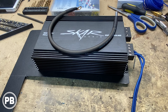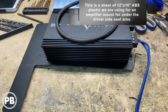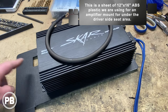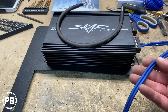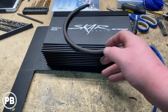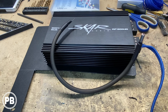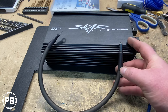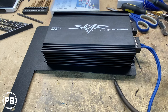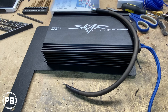We spent a little time prepping our amplifier. With the seat rolled back, we measured the shape. We're going to snag the rear seat belt bolt and nuzzle the amp right up underneath the seat. We cut a small hole so the airbag harness can fit through without being impacted. We've got a nice long run of OFC 12-gauge speaker wire going to the trunk, our ground ready to go at the factory ground location on the ridge the seat bolts to, and wire ferrules on everything — on the ground, power wire, and remote turn-on wire. The ground end has a ring terminal with heat shrink, all cleaned up and ready.